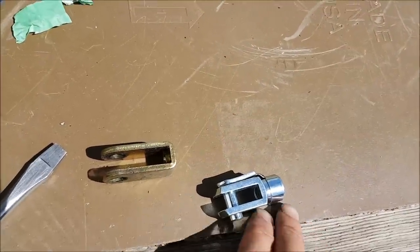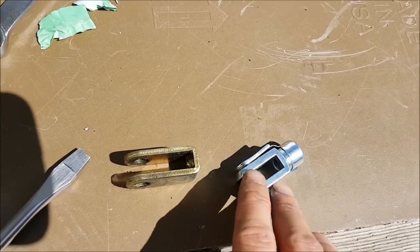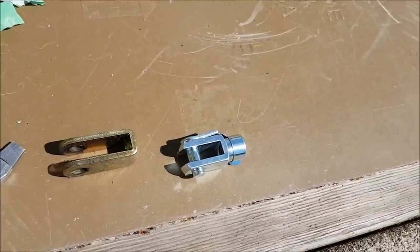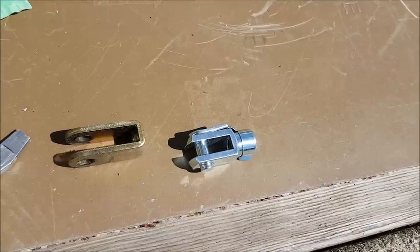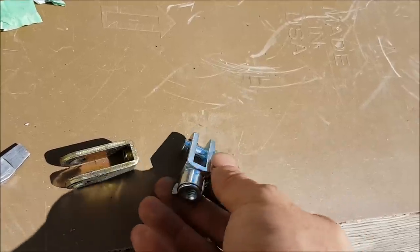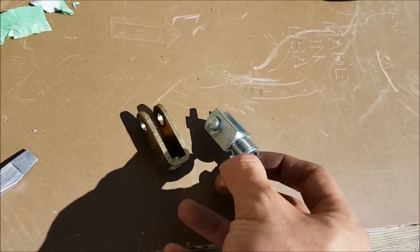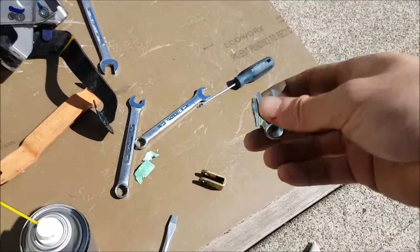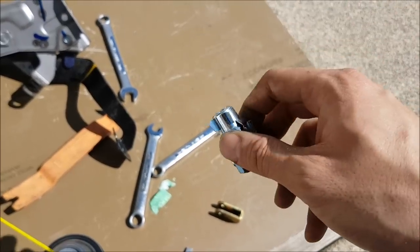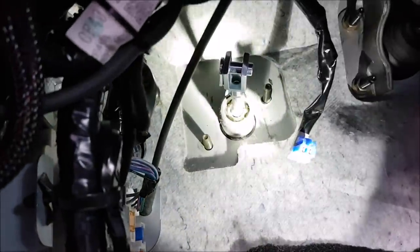I splurged a bit and bought the new heavy-duty clevis from RGM. It's really not that expensive, and you can see the tolerances are a lot tighter — this will make sure we have a much better clutch pedal action and it's going to feel a lot more precise. They also improved the design — these are all machined in-house so the retainer is built into it, it clips on, and gravity is on your side. Before I took out the old clevis, I marked it and counted how many full rotations I took it out, so when I put this one on I count how many times I put it back to get it in pretty much the exact same spot. With the clevis in, I'm ready to put the clutch pedal assembly back in.